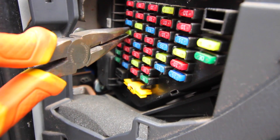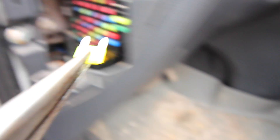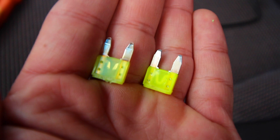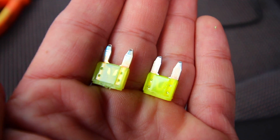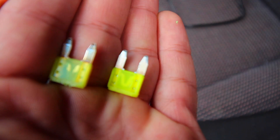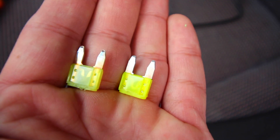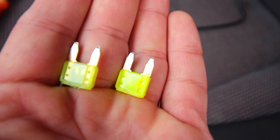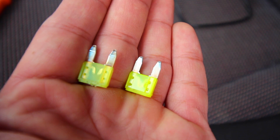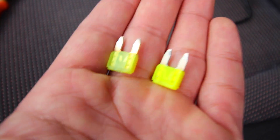Behind here, that 20 amp fuse attached in the back — we need to pull that out. We'll take that out and examine it. The one on the left is the one we took out of the car, and there's nothing connecting the left side of the fuse to the right side — both prongs are just sitting there, not connected. If you look at a good fuse on the right, you can see that little wave — a piece of metal connecting each side. If you overload the circuit, that fuse is the first thing to go. It's there as a safeguard so that if you run too much power, you're not ruining any wires or causing an electrical fire. All that gets damaged is the little fuse, which costs about 10 cents to replace.